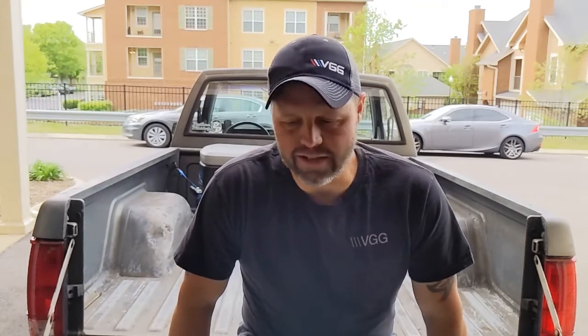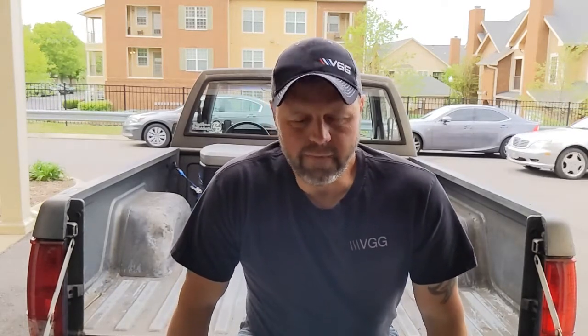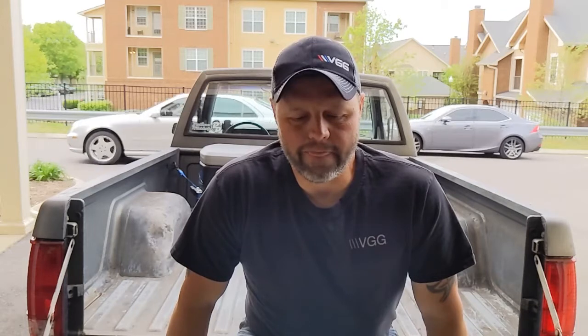So a couple tips about washing your vehicle with a Scotchbrite pad. When you are washing your vehicle with Scotchbrite, to give it that matte or flat or patinaed look, take your time, go slow. Go in one direction, don't go up and down and left and right. There's a couple spots where I had to, like going around emblems and door handles, so be real careful, because you'll be able to tell. Use a red Scotchbrite, not a green one. The green ones are a little more abrasive, scratchier. So use the red Scotchbrite. Seems it works pretty good.